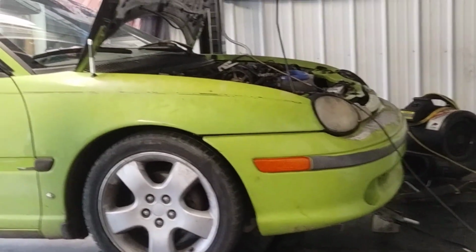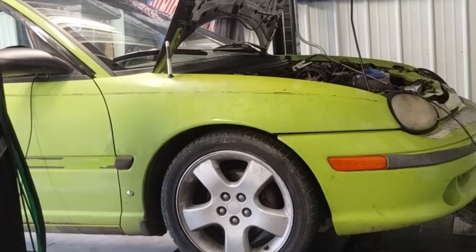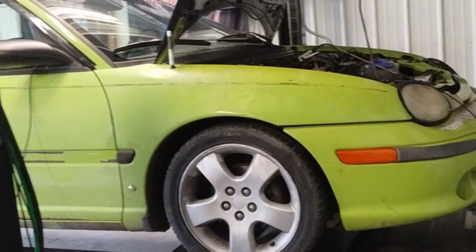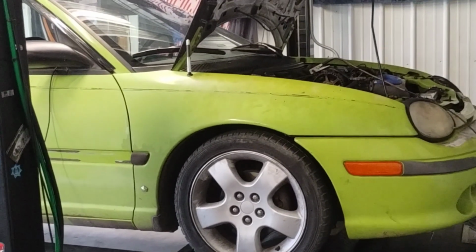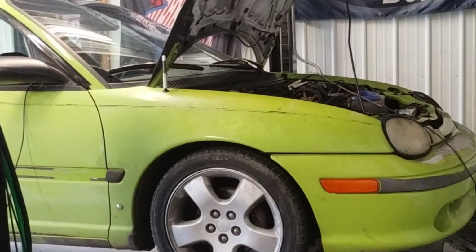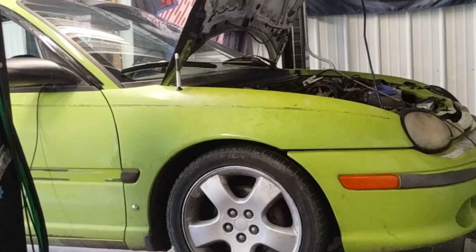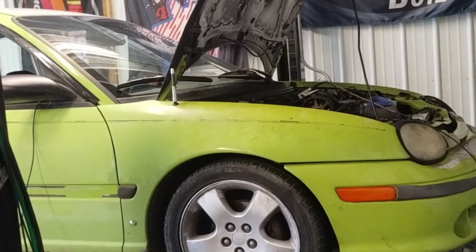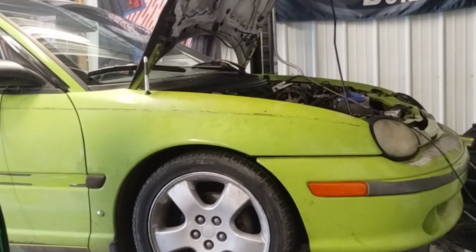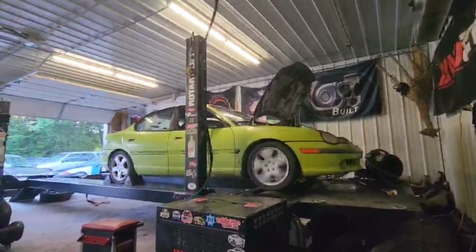And just for you guys, the nitrous kit is still on this car, the intake and everything. This is a wet 65 shot with a nitrous bottle at room temperature, no torching, nothing crazy. So on the next hit, you're gonna get about 3,800 RPMs, 4,000. And as soon as I see it click 4,200, I'm gonna spray it. And we're gonna aim for right at 200 wheel horsepower. I think with a 65 shot, the 135, 137 horsepower, it should make 200 on the dot, and it will probably make 210 wheel torque or something close to that.